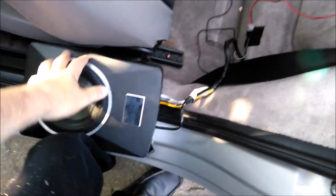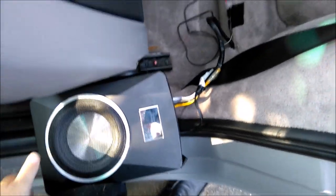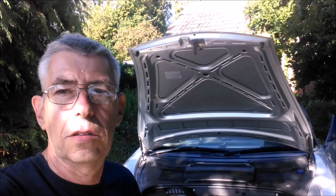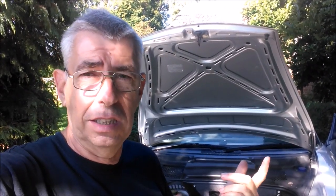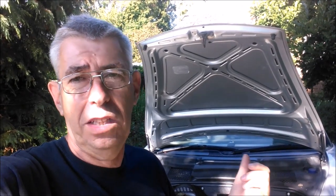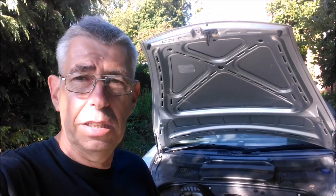That's the two front ones out. Now we've got to move the seat forwards and get the two rear ones out. Because I haven't got a lot of slack on the cable on my subwoofer, that's probably going to get in the way. I've got the subwoofer balanced on the edge of the car, keeping my knee wedged against it while we undo these two rear bolts. Now we're just going to disconnect the battery because the seat's unbolted and we've got to unplug all the electrics. It's still good practice to disconnect it for safety and to avoid shorting anything out.